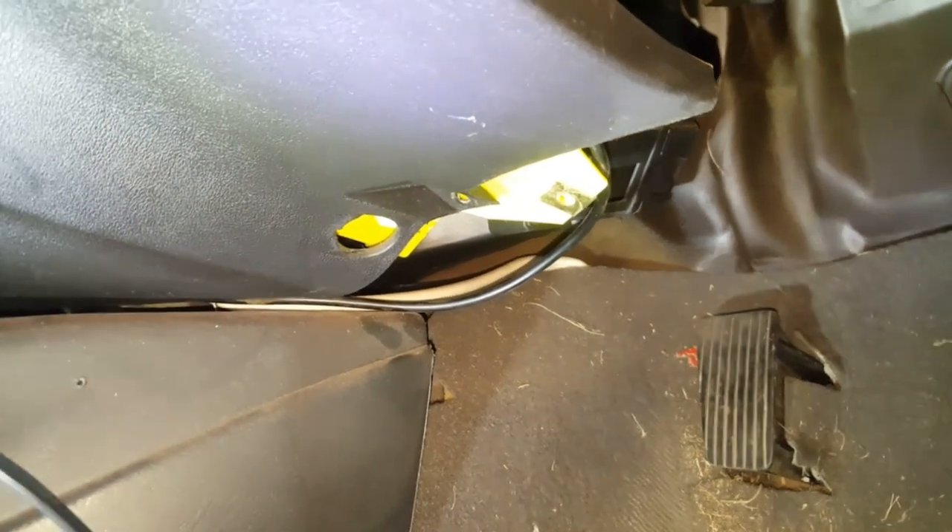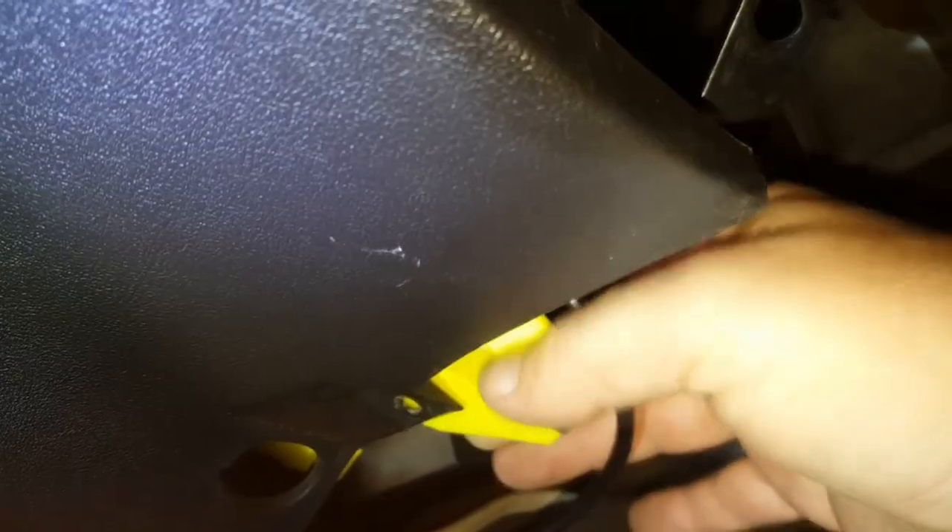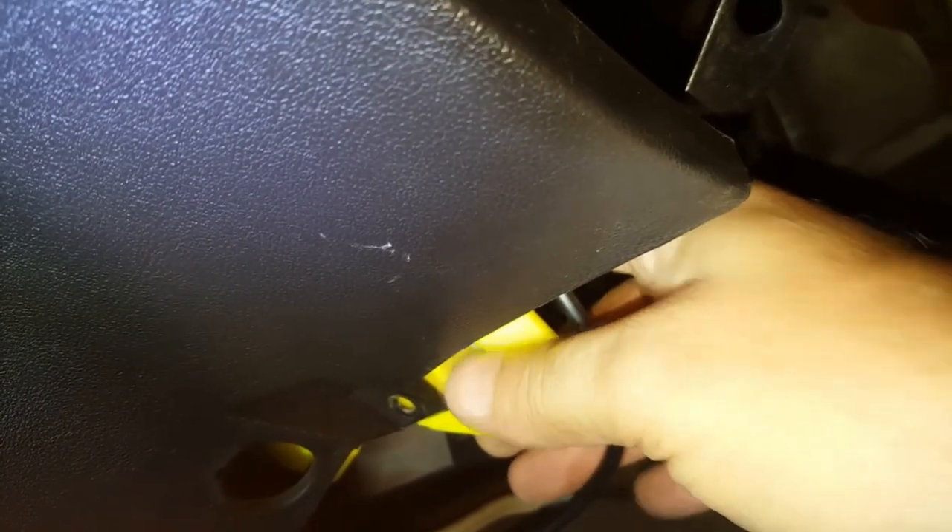From the outset I can tell you it's not just an easy remove-that-screw-and-it-drops-down. There's a cable tie holding onto the harness that I can't see from this side, and there's also an arm here that stops you from getting it out. You have to wiggle around everything and then move the arm out of the way. I need to get that cable tie cut on the other side to free it up.